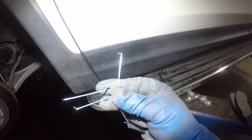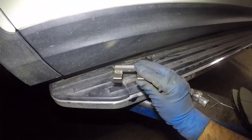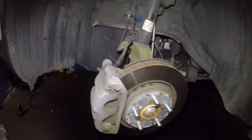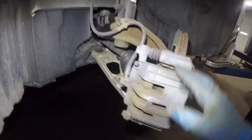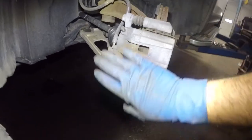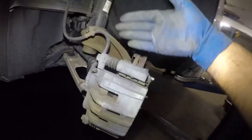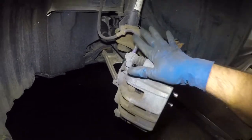It's the same procedure for the opposite side. The kit comes with four brake pads and four hardware kit shims, so we're gonna replace all that. Very simple — all I did was turn the wheel a little bit to the left to bring the hub out. Now I'm gonna remove only this bolt and then lift up this caliper.